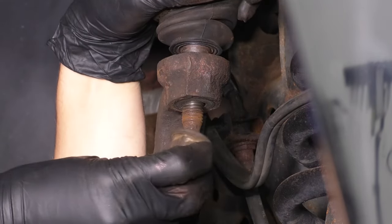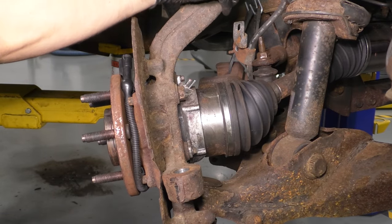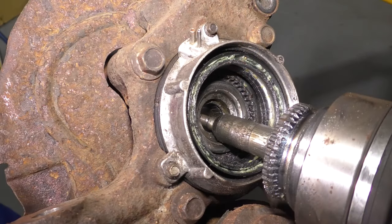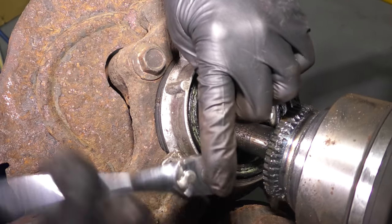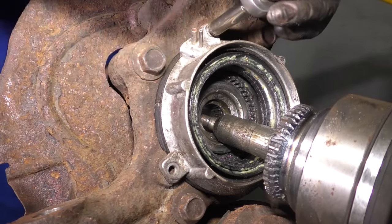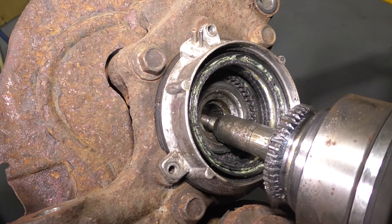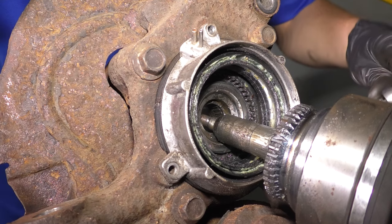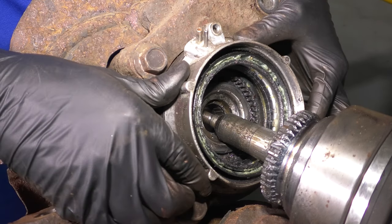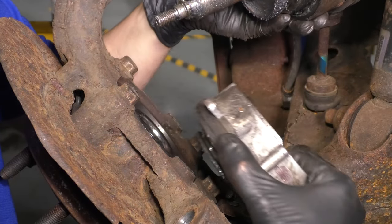Press the control arm down and remove the mounting nut, then let the control arm go up. As the knuckle comes down and forward, make sure the axle pushes through. From the back of the knuckle, you have three 8-millimeter bolts to remove to get the vacuum hub actuator off. A lot of times these will be seized, so try spraying some rust penetrant. This one has been recently serviced so there's still grease on the bolts. With the third bolt requiring the axle to be moved aside, and all three bolts removed, you can pull the hub actuator off — the best way is to lift the axle up and out with the actuator.